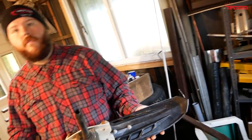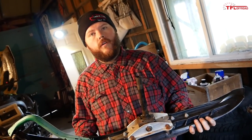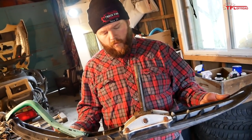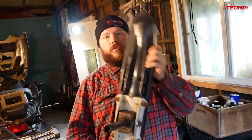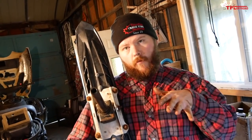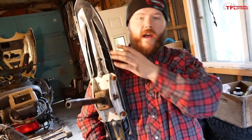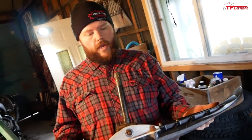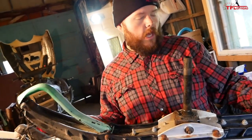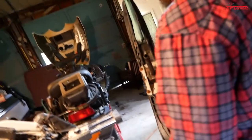For the do-it-yourselfer at home, we have upgraded an O2 Grand Touring with Pro Pilot skis off of an 04 Rev. So it's doable. You need to do a little bit of shim work in here, and you need to manipulate that rubber a little bit. You're going to need the rubbers off the Grand Touring, not off the Rev. However, it's doable. And this is a lighter ski. It's in better shape than my steels were, and should be good. It's got sweet green tips on it. Woo! That don't color match at all.